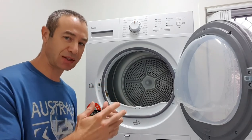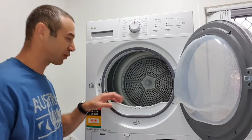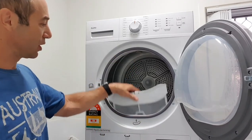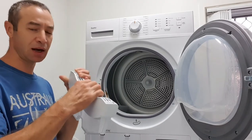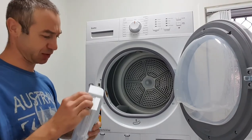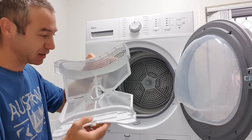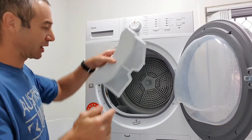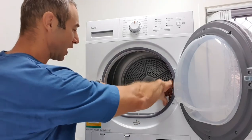With heat pump dryers, if you don't empty your lint filters, it will clog. Inside it looks like an air conditioner — that heat sink or radiator has very fine fins. It is really important to filter out all the residue before it hits that internal filter. The first filter is inside the tumbling chamber. Open it up — it looks like this — it will be full of dust. Open it and it should unfold easily. Scoop everything out, put it in the rubbish bin, close it, and slide it back in.